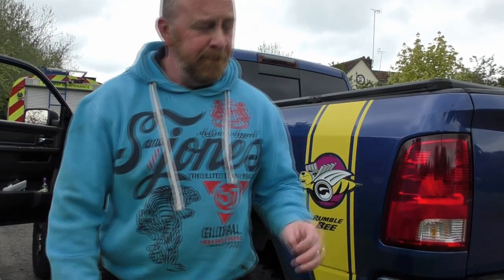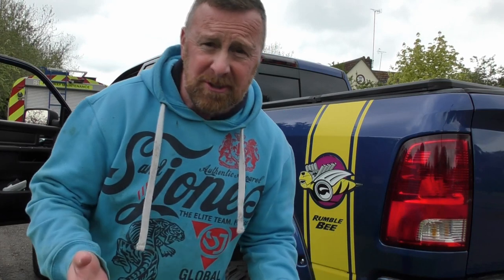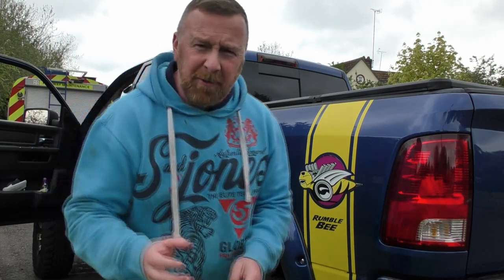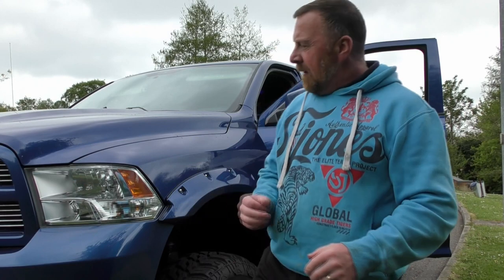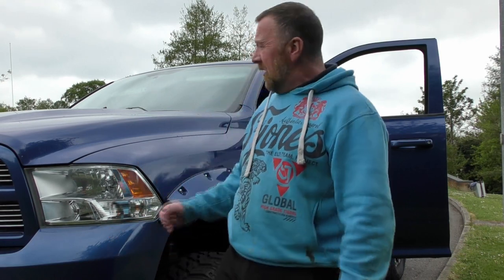How about this — bonus! When she's ticking over, it's got a deeper tone, but a little bit quieter. So: cold air intake filter, new plugs, muffler delete — or exhaust box taken out, as we call it. That does sound a beautiful burble now. In gear, when you put your foot down — I've often found, no disrespect to the little lads with the 1.6 Voxes and the cut-down exhausts and big boxes, that they sound deeper but look like they're going nowhere. Losing brake horsepower to back pressure — there's no argument about that. When you've got a 5.7 litre, 360 brake horsepower engine, it doesn't make a blind bit of difference. What it does is make it sound a lot nicer and it's changing gear a lot better.